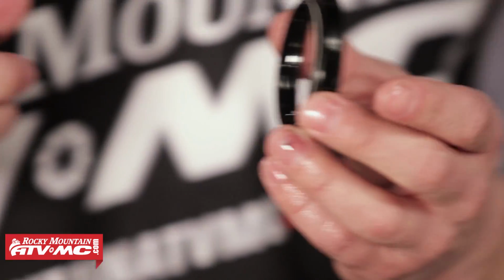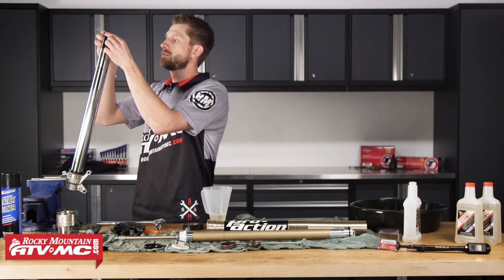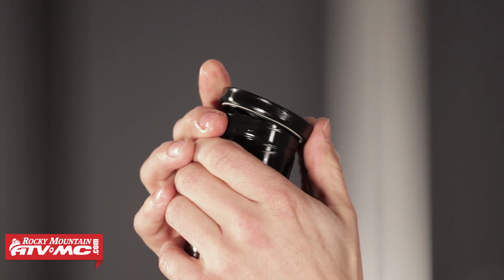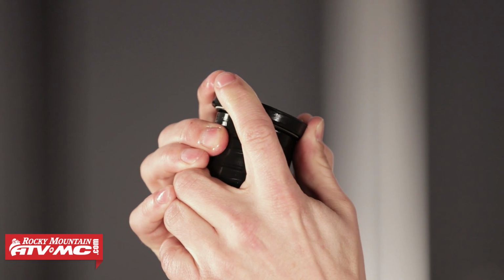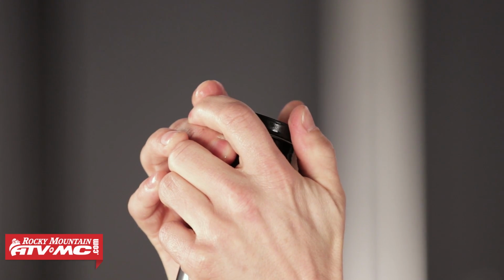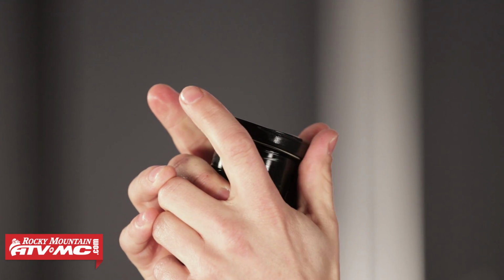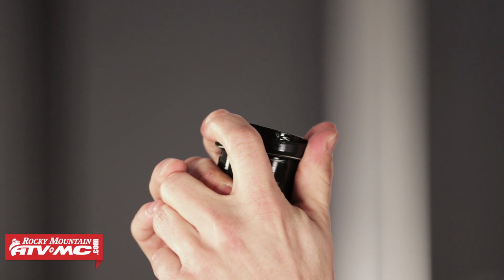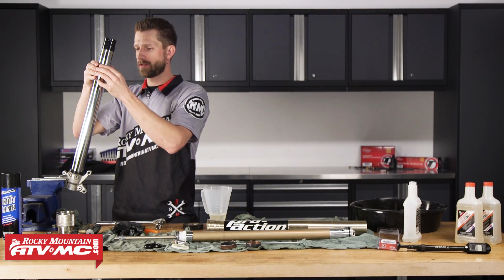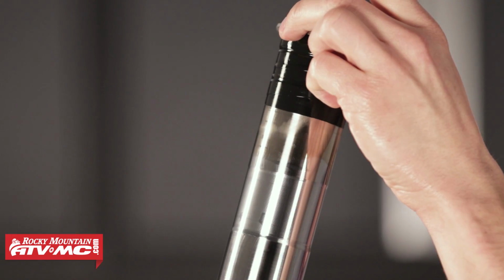on our inner tube. Now when we place this onto the inner tube, I like to set it on there ever so gently at a bit of a slight angle. So then I'll push on this side of the seal, and then I can bring the other side down into place. And this just helps reassure me that we're not going to be catching any sharp edges. So I'll work it from side to side. I'll press on this side, pull this side down, then I'll press on the opposite side, pull this side down. Now that we've got those obstacles cleared, we can slide this into position. Next will be followed by the collar, then the washer ring.